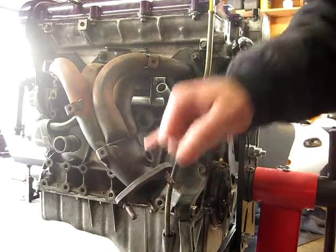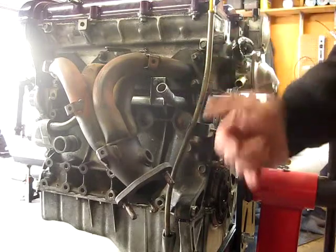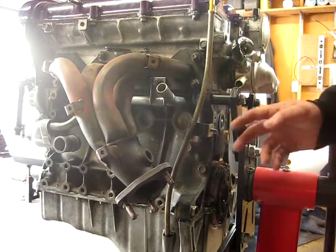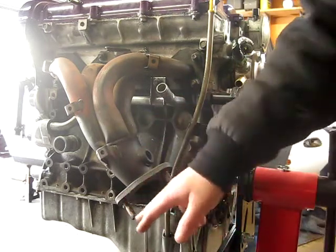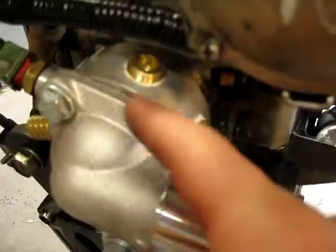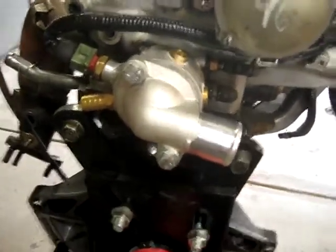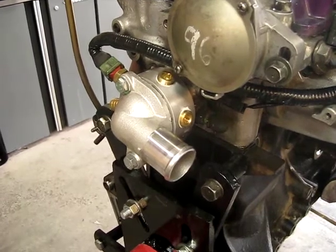You can kind of predict what unexpected things are going to happen. For example, if I had bet that a stud on the exhaust side would break, or a bolt somewhere would snap, I would have won. Luckily, none of the studs on the head broke, but the stud on this flange — it didn't break, but the nut was so seized on it just pulled the stud right out. Doing the coolant reroute, I'm pretty sure I'm about done. I'm so terrified of it leaking — apparently they're notorious for it — but I tried to get sealant in there and thread sealant on all the fittings, which should prevent leaks.